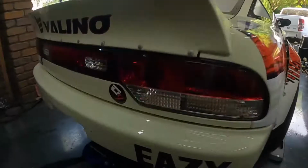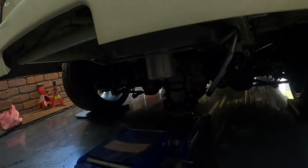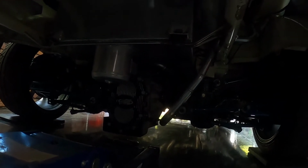Now we'll duck under here. I'll get a light on. So we've got the Winters quick change and all the Wiring Fab. Our lines are there for our radiators and fuel tank. A little bit of a mod on the fuel tank and a little swirl pot put on the bottom so that we can just run the in-tank pump. That's about it. So it's all cut out.